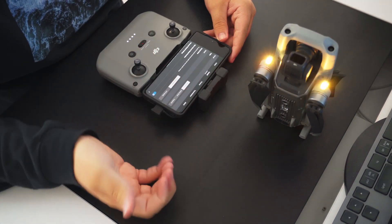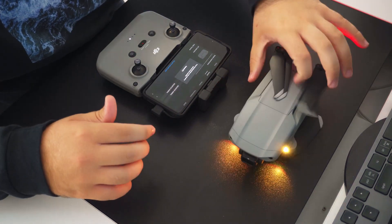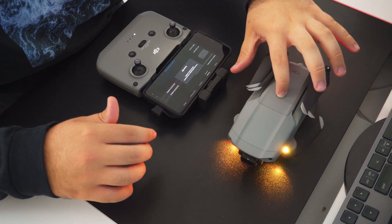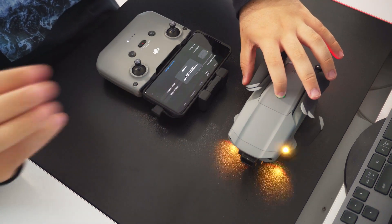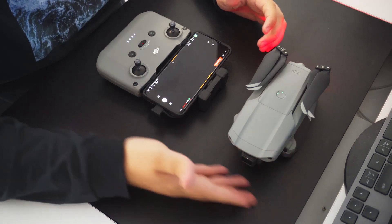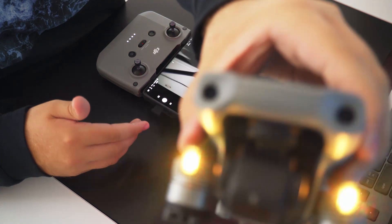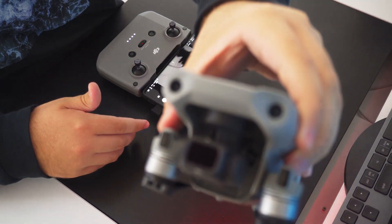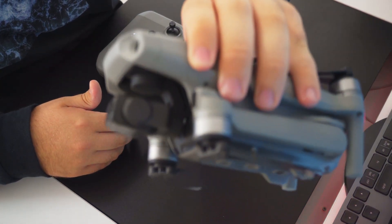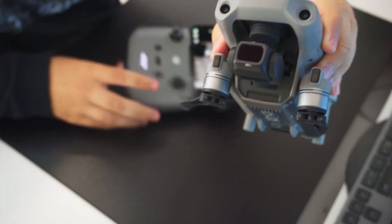First, power down the Mini 2 and go back to the main screen in the DJI Fly App. Then power on the Mavic Air 2 and wait until the lights flash yellow. Once they are, press the power button down for 4 seconds and wait for it to beep. Then press the repair button found in the control tab of the settings page in the camera view for the Mavic Air 2 in the DJI Fly App. The drone and the controller should connect in a few seconds, with the camera feed confirming this.